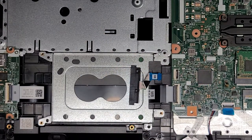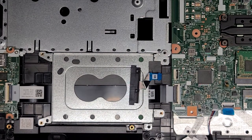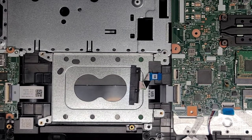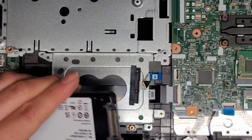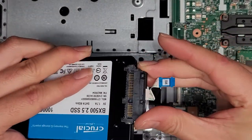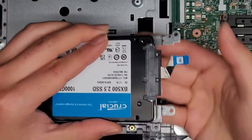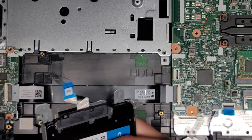We've got the connector here. Let's go ahead and get the SSD — they asked for a one-terabyte SSD. If you need a link to it, just let me know. We've got the SSD out, it comes in nice packaging. I'm going to put their old hard drive in the packaging. We're going to connect the SATA connector onto the SSD, and again, be careful — this cable is pretty fragile. We'll drop this in and get the four screws back to hold the SSD into place.